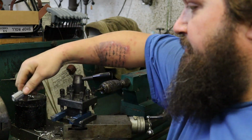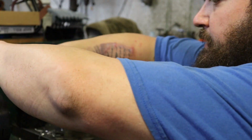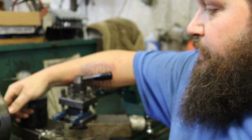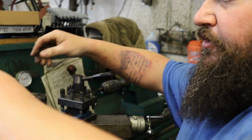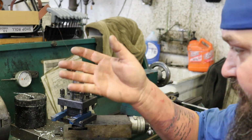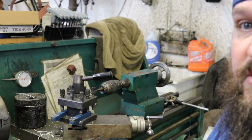We put it in the lathe chuck. Tighten it down nice and tight. It squeezes the slot and locks down on the bolt without damaging the threads any. So that allows me, I'm going to go ahead and machine the head, and then we'll polish these bolts.